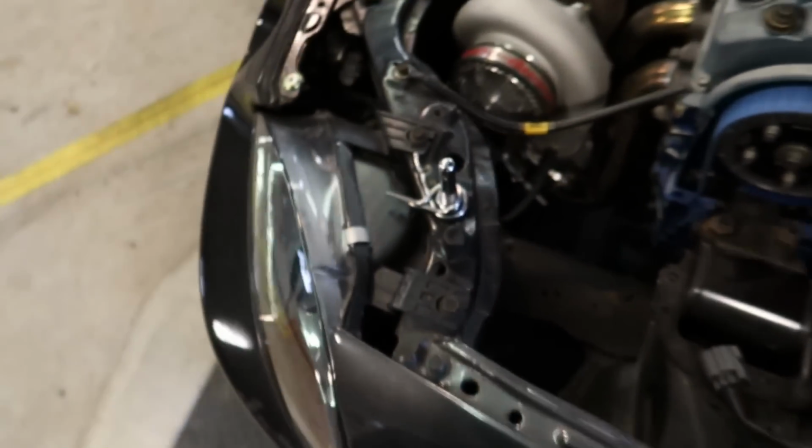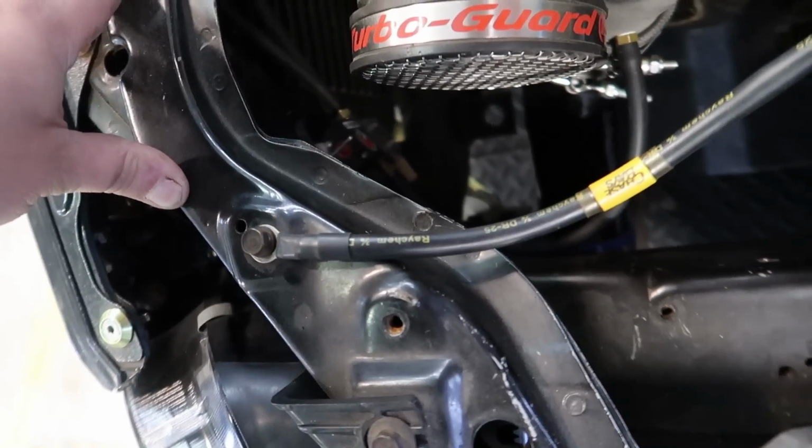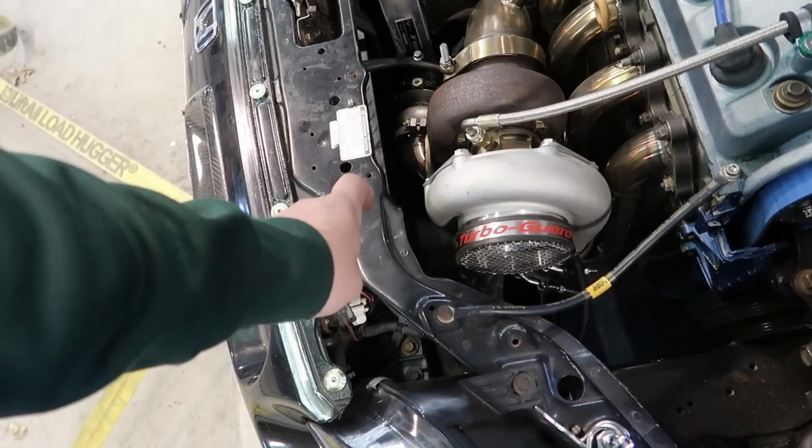All right, so making pretty good power, but we want to make more power, and we got to turn up the boost to do that. So this car has a Speed Factory 4-port boost solenoid on it, and I'm assuming it's plumbed right. I'm hoping it's plumbed right. So we were checking the wiring, and I went into the Hondata under the outputs or test outputs, and you can click it on to see if it starts making some buzzing noises or vibrations, and it wasn't doing anything.